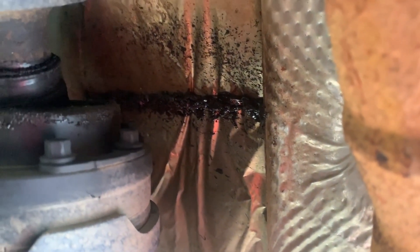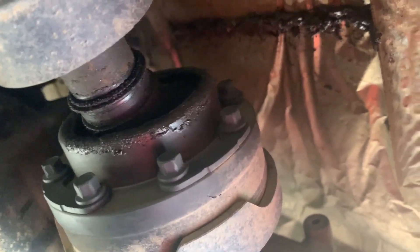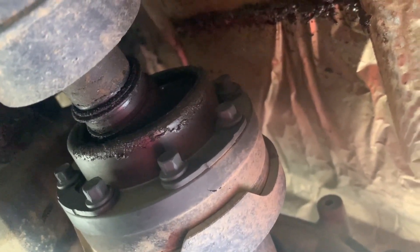I'm almost certain — I've talked to a couple people — it's either my whole drive shaft or just the CV joint. I got a little bit of sludge up under here. There's the sludge on the CV joint itself. That's typically what happens: it gets overextended, it just explodes and you get all that nasty stuff all over there.